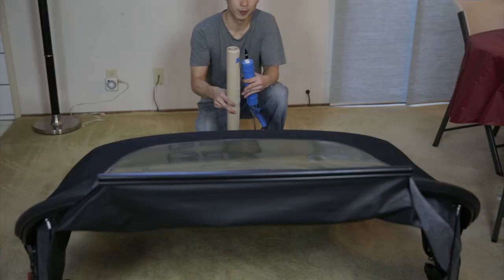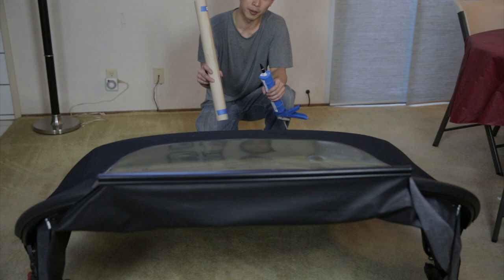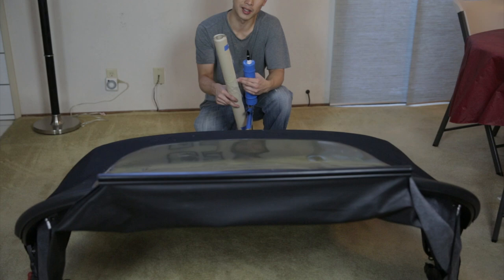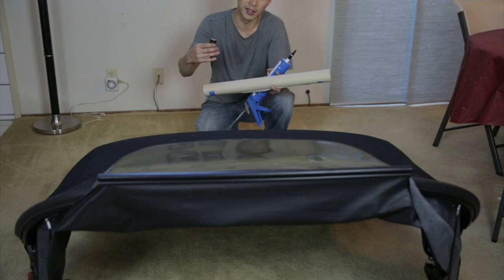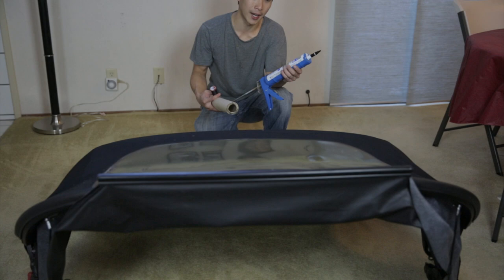You only need a few materials to do this. I've laid out the soft top — you're looking at it from the rear of the car towards the front. I bought some of this from Tap Plastic. This is a car rear window vinyl; it's clear and specially made for cars with UV resistance. You also need UV resistant outdoor thread so that when the sun's beating down on it, it won't disintegrate — if your string disintegrates, the window will fall off. And finally, you need some black silicone sealant to make it waterproof, sealing all the edges so it doesn't leak when it rains.